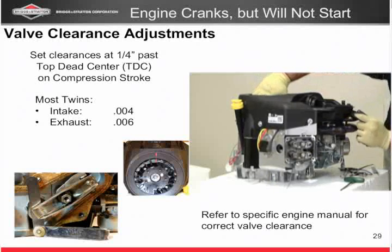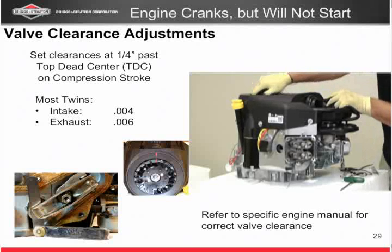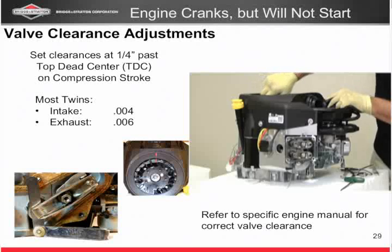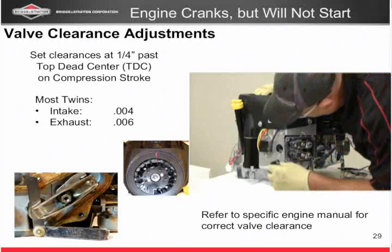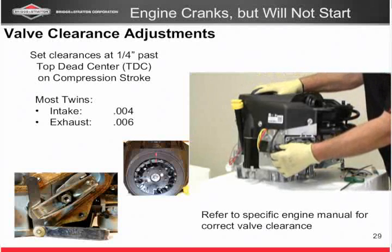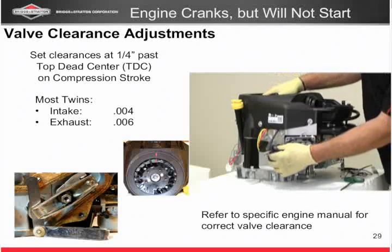To do that, we're basically going to watch our intake valve go down. As that comes back down to the seated position, I know that piston is coming back. We're going to cycle this all the way through — exhaust, piston going down, intake pulling the fuel in. Valve is closed, so my piston's coming up. Now I take my straw, put it in the plug hole, and I'm going to feel that piston come to the top. As the straw comes up out of the piston hole I know I'm getting near the top — you just watch for movement. When that straw gets to the point where it does not move anymore, I'm at top dead center.